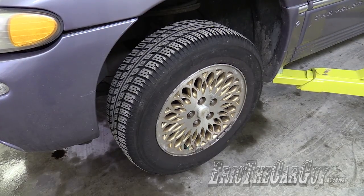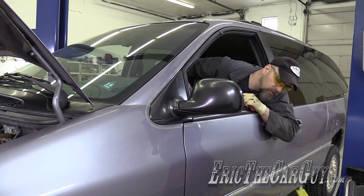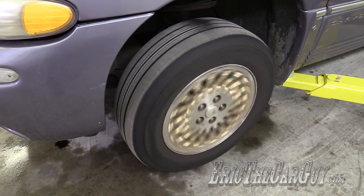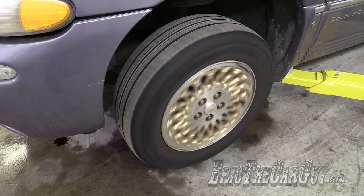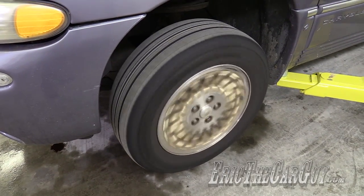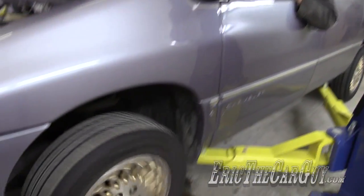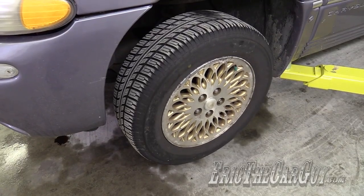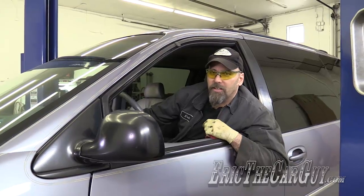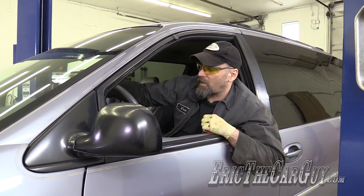Let's drive forward gears. Okay, we've got at least first — the ABS might start to kick in with it being off the ground like this. Actually that's traction control I think. I just turned the traction control off, yet it still seems to be engaging. The really odd thing is the speedometer is not moving, and usually when I do this the speedometer will move.